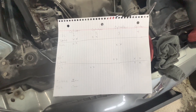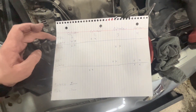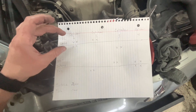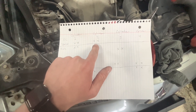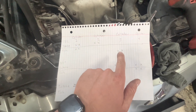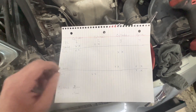I've drawn up a diagram here to show you — when it's on top dead center, you're going to want to adjust the intake and exhaust valves. Specifically, you're going to adjust cylinder two intake valve and cylinder three exhaust valve when it's on top dead center.